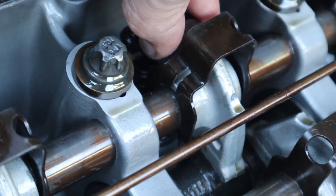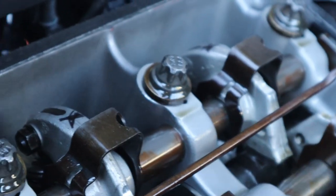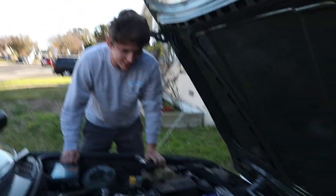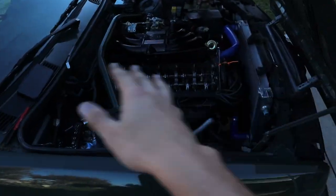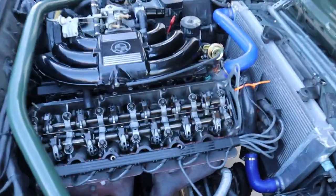Now that this one is on a low point, you see I can wiggle this — and that is your valve adjustment right inside of there. So now that the camshaft is at that smaller position, it's important to note: if you take out your spark plugs, it'll make turning that much easier. What Jacob's doing right there is turning the crank nut by hand, and that's not easy when it has compression in the motor. If you take your spark plugs out, you can do this a lot easier, a lot quicker. But we're muscling it right now because we've only got a few to do.